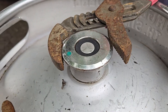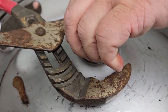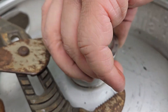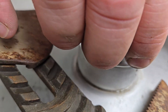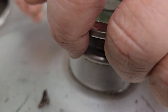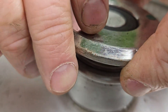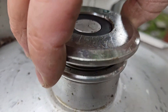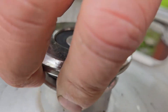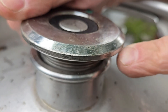You're going to have to twist this off. You've got to figure out where your lock is, because it's locked in here. What I do is I pull up on one side and spin it, and then wherever it gets lower — see, that's lower right here — so our lock's right here.